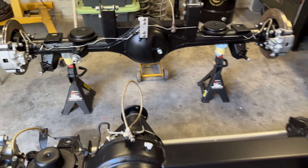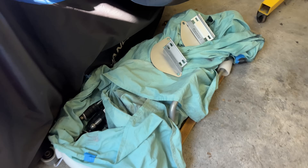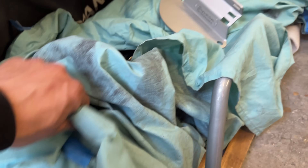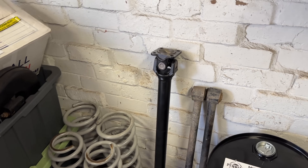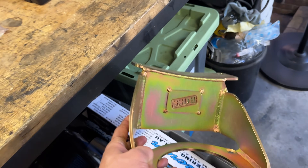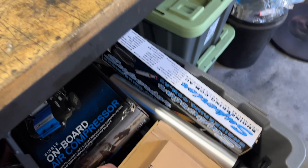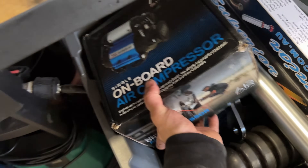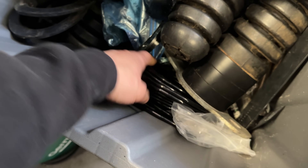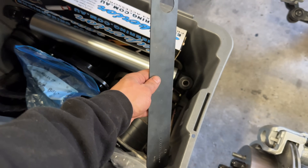These are going to look great under the car. Next weekend these will be going under the car along with all the suspension - we're just waiting on the front long arms to come. We've got all the suspension wrapped up: Dobinson shocks, remote reservoir holders, Superflex sway bar, all our arms ready to go, old coils, new front tail shaft, and a couple of boxes of goodies. Coil tower bracing for the rear, the Superflex sway bar kit, locker activation kit, compressor for our locker, chassis mount steering damper, sway bar links, bump stops, spacers, diff breather hoses - just all the fittings for the long arm kit and everything.